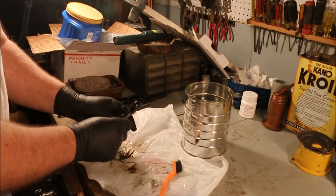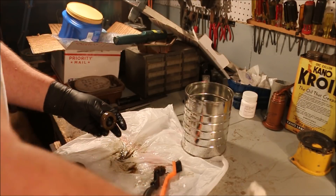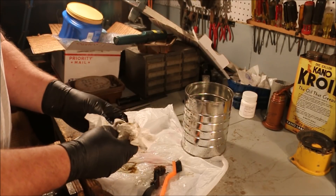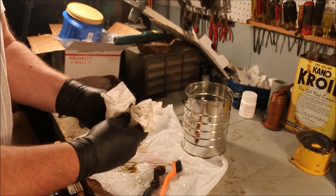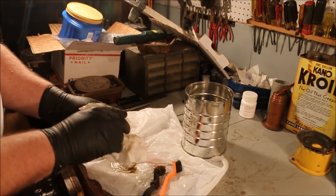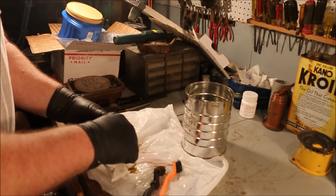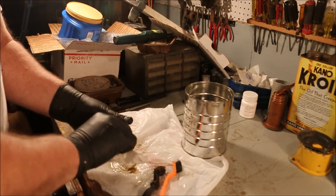This chunk on the float — I've always heard it called varnish. I don't know if it is varnish or just related to varnish, but it has some of the same characteristics, and fortunately it is dissolved by mineral spirits.